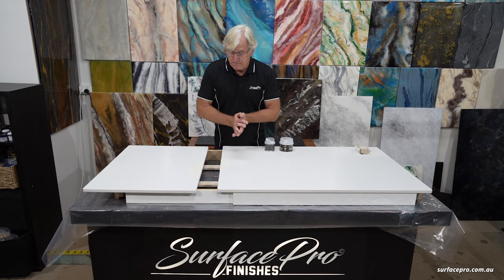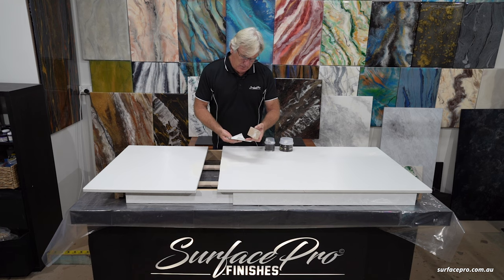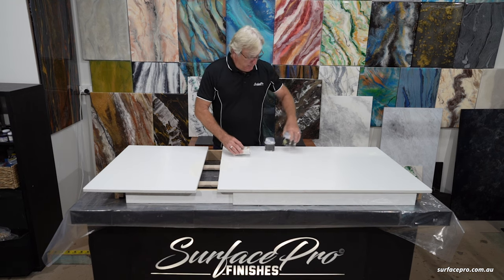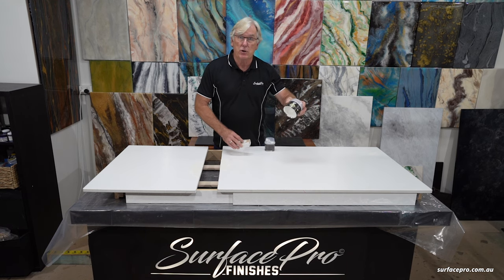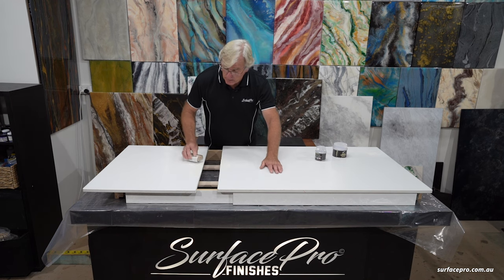So that's dried nicely. Now I'm going to sand it back, and I've just got my cork block. I'm using about 240 grit. Very fine. That's all I need. This will sand back nicely. Very, very impressed with it. By the way, the universal polyester putty from Montana comes in a 500 gram size and a 250 as well, which is what I used. Hardly used anything at all. Fantastic. So away we go.